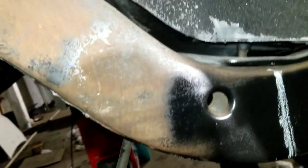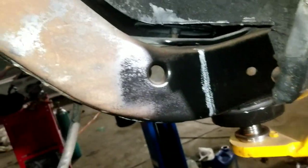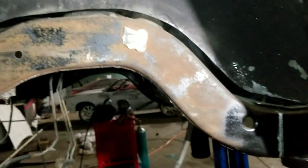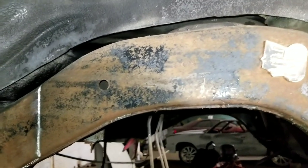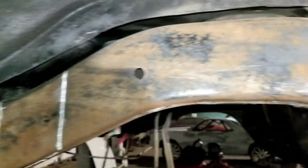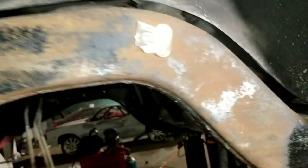I'll walk y'all through the whole process, where I'm already filling you in on the frame notch. I'll fill you in on the rear end specs and the wheel specs, so everything falls into play. You want a 7-inch lip, I give you the specs. All you gotta do is hit your wheel provider up: hey, I need a 24, 7-inch front lip, 3-inch back lip, and I need the backspace such and such, offset such and such. So I'm gonna let y'all know all that. About to get to chopping on this side. Just got my marks.